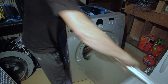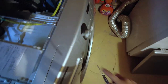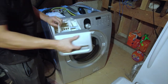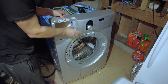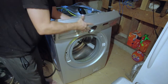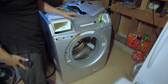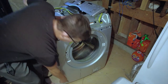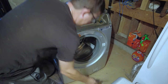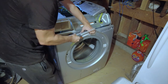Now we have access to the top of the machine. Up here we're going to be removing this piece — there are one, two, three, four screws to remove this top piece. On the top of the front cover there are also one, two, three, four screws, and there are two at the bottom — one right here and one on the other side. So let's get these four off and remove the two at the bottom. I just take a screwdriver — there's a clip on the top here — stick the screwdriver in there, lift it up, and that pulls out.